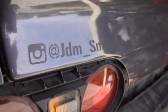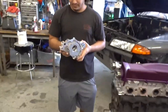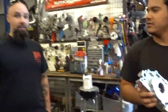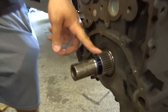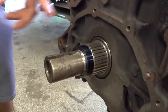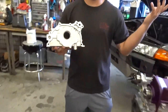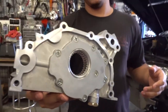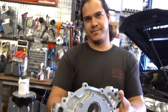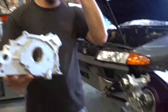Roberto has got something cool in his hand. It's a Super Tech racing piece - it converts the factory RB26 single notch spline, which is horrible, to a 2J-style multi-spline. You can see inside there's actual spline drive just like the 2JZ. This fixes the oil pump starvation and oil pump drive breaking problems with high RPM use.